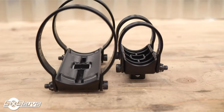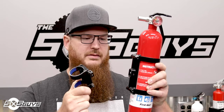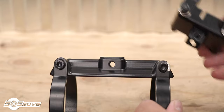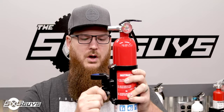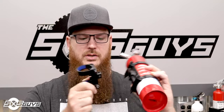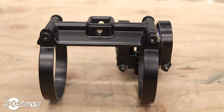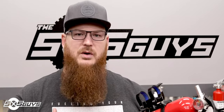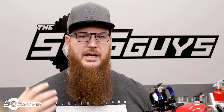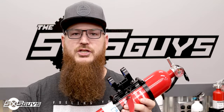The pin comes out easily with no problems. The mount is a one-and-three-quarter-inch cage mount, and the extinguisher mount bracket and the roll cage mount bracket come together at a single square point. You can mount it in a vertical or perpendicular orientation because of the square bracket, which has holes on both sides. There's a plastic insert in that square to reduce vibration and noise and create a tight fit, which is nice, but it will degrade over time as weather and climate wear on that plastic.